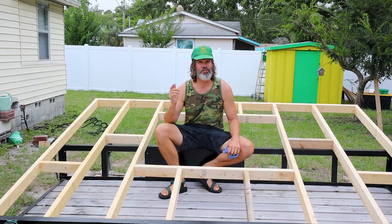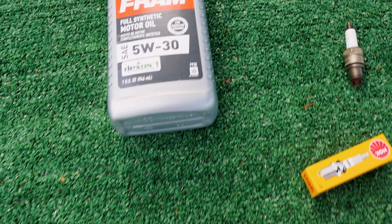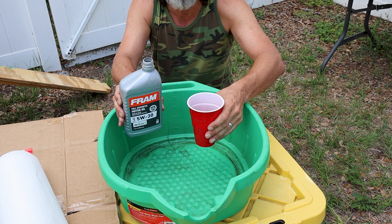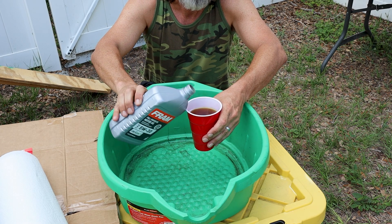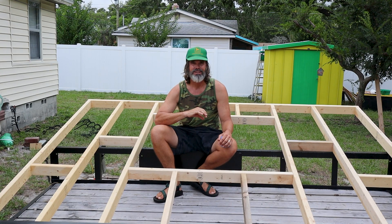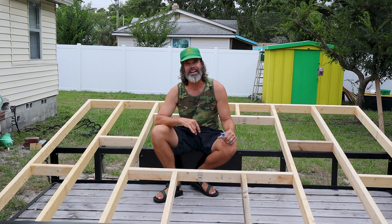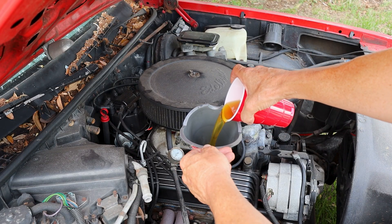Welcome to Gulf of America. Here's your tip before you skip: if you're changing the oil on a small engine and the capacity is less than a quart, you don't want to overfill it. Get a Solo cup and your quart of oil. My particular application uses six tenths of a quart, so we need to get down to the 600 milliliter line — that means we take 400 out. That top ring on the Solo cup is a fifth with an honest amount of ice, or 400 milliliters. Pour it up to that line, verify you've still got your 0.6 quarts left, then donate that oil to a machine that needs more than you.